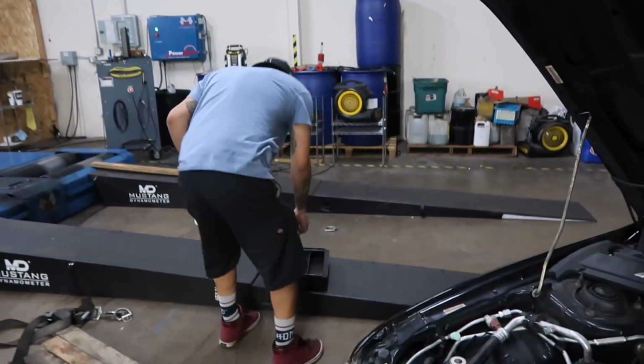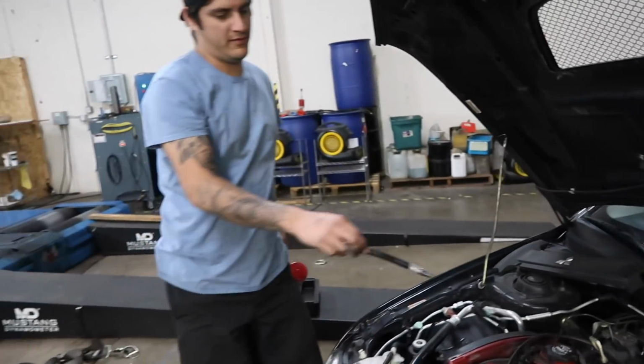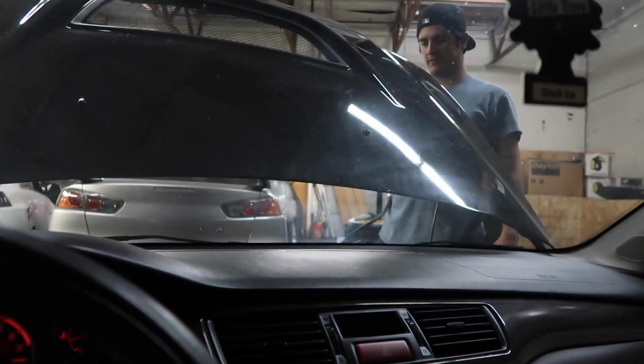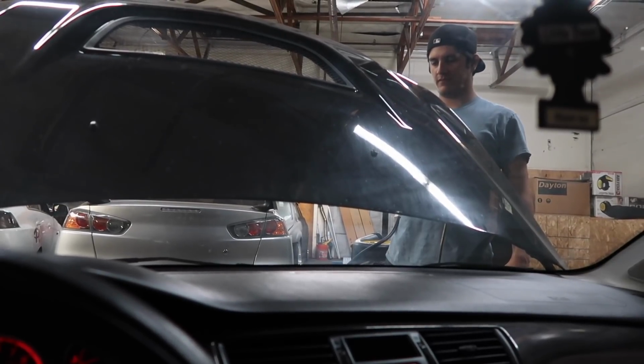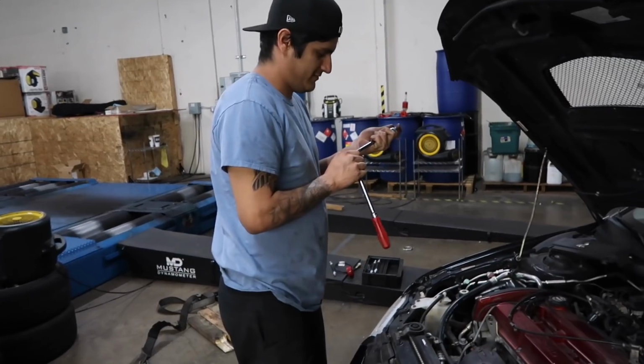Alright, so the plugs are out. We're getting ready to see if my motor is complete caca or not. We just tested cylinder 1. It tested 155. This is so scary, you guys have no idea. So 155 across the board with all the cylinders. Thank you, David, for peer pressuring me into this random test at basically midnight.